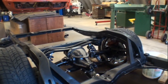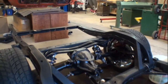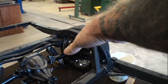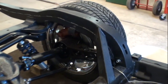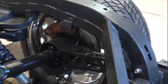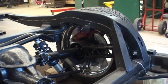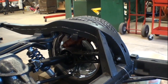Okay, we're really not done with the suspension because a Corvette has independent suspension on it. When we say independent suspension, you can see this has two drive shafts, and then you've got independent control arms, basically like a Volkswagen. Now, are these the original control arms, or is some high-tech factory stuff going on? They're not factory original, because I'm lowering the car. It's kind of screwing with the stock geometry. Plus, getting wider tires.